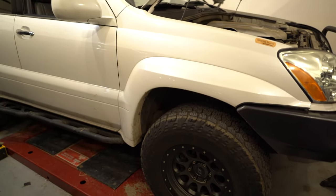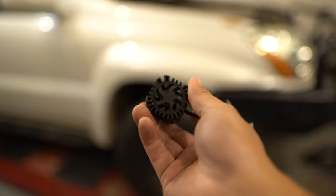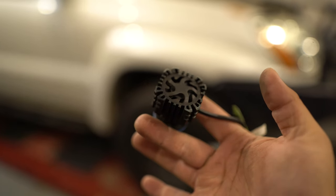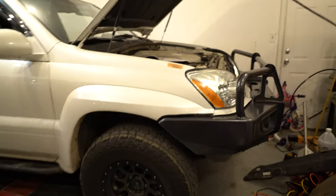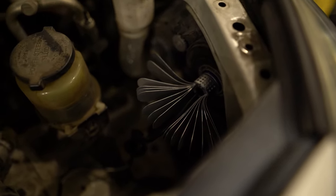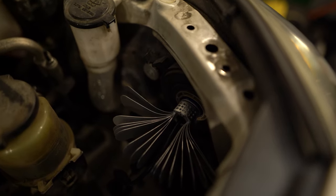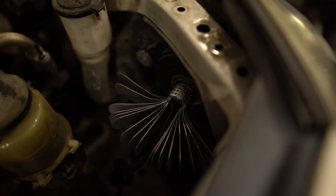This bulb's setup is similar to the DMM — it's got a fan built in behind the bulb to keep it cool. The DMM failed me after one year of use. I stopped hearing the fan on that side, so I'm pretty sure the fan went out. That's one downside to having a fan on your LED bulb — it can get dirty and go out, and then soon after your bulb will burn out. That's what I think happened.